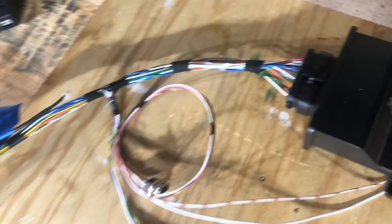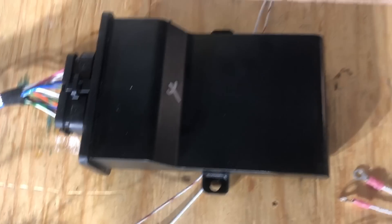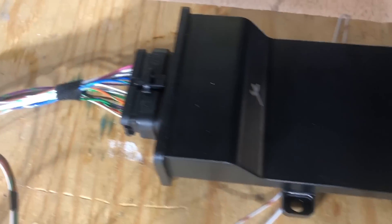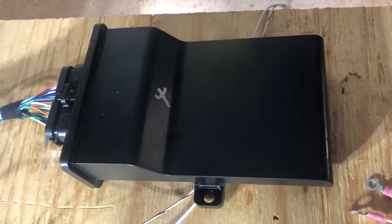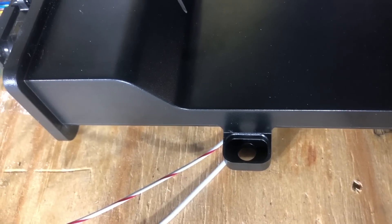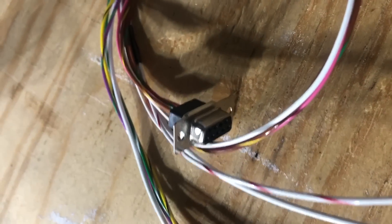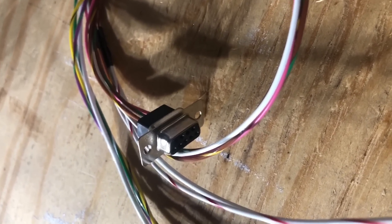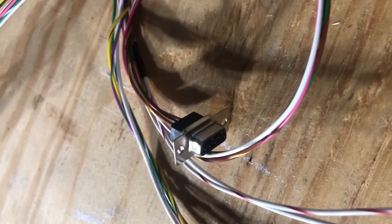Other than that, there are just a few wires. The main ECU — engine control unit — plug has to be connected to the computer, and there are many different ways to mount it. Sometimes we zip-tie it upside down hanging underneath the glare shield, keeping it vibration-free and separated from the airplane, though you can also use rubber mounts. There's also a connector used to program the ECU, and optionally a data logger with an SD card where you can log every flight and review it on your computer at home.